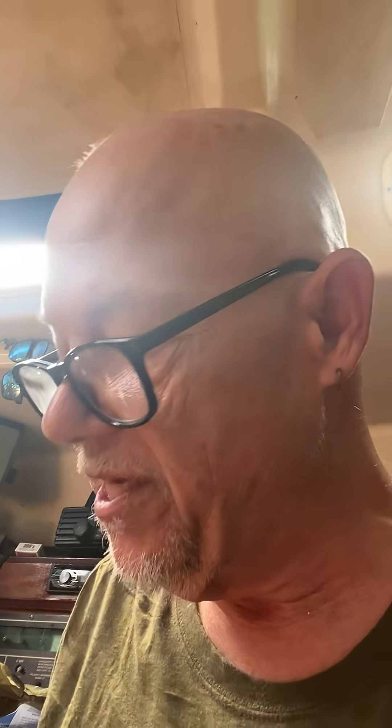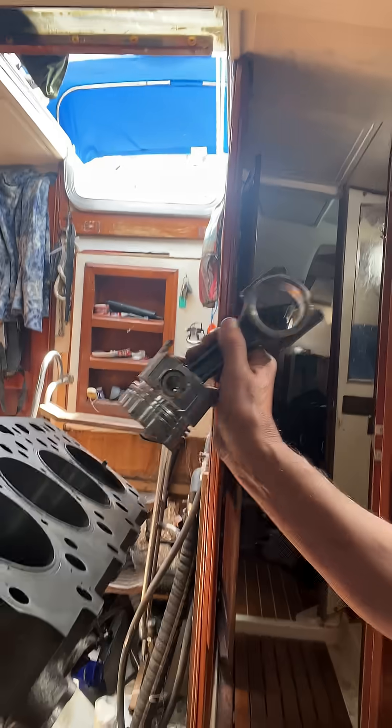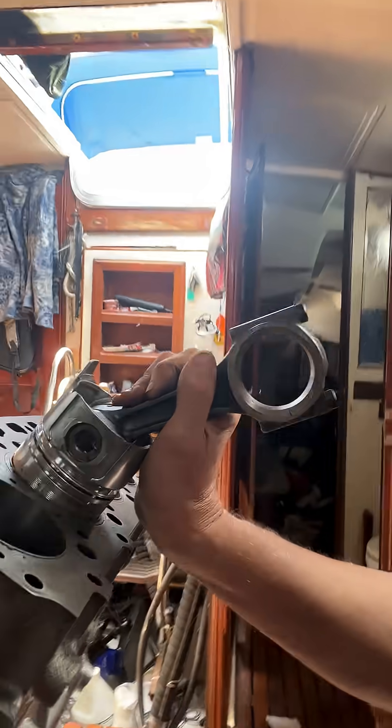The thing is, these new liners are thick — they have to be cut. About a millimeter of steel has to be cut out of the center of them before the piston will fit down inside there and travel. They won't go in there no matter what you do.